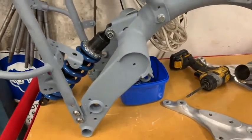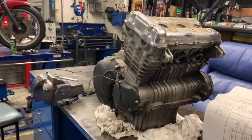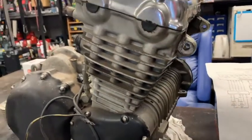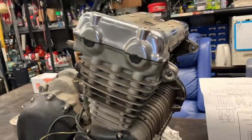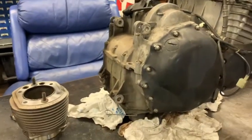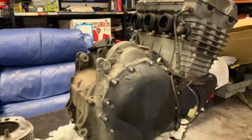The motor and stuff is still all up in the air — I'm not sure what I'm going to do yet. Whether I buy another motor or rebuild this one, which is sitting up on the bench — it's the motor that came out of it. I think I've worked out what the water in the oil was. These have wet liners — cylinder liners — that push into the block with sealant around the bottom. This is a 20-year-old bike and I'd say the sealant's failed and it's just pouring water in through the bottom of the liners. It's super rare on bikes to have a head corrode and pour water like that. Sometimes you get it through the water pump on certain bikes like old K100s, but even then they have a drain hole between the oil seal and the water seal at the water pump.